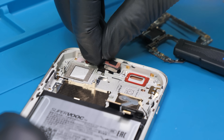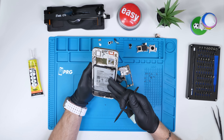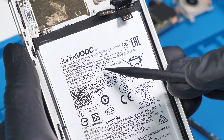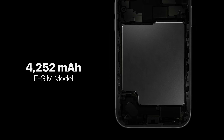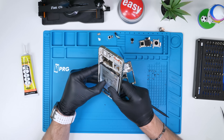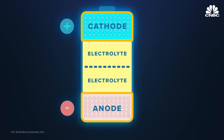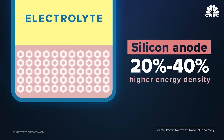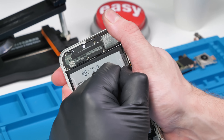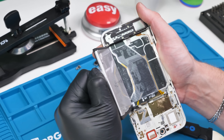We'll remove the 50 megapixel front-facing camera, and now I can talk about this massive battery. It's 7,500 milliamp hours, which is almost twice the size of the iPhone 17 Pro. They're using a silicon carbon battery here — still made of lithium, but instead of graphite anodes like most phones, they have silicon carbon anodes which have a much higher energy density. That means you can get almost two full days of use without charging, and the battery health should stay at around 80% for five years.